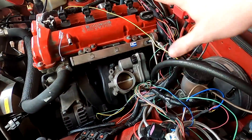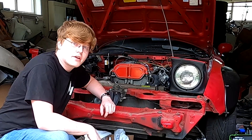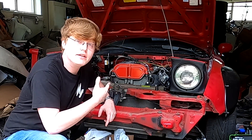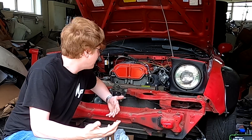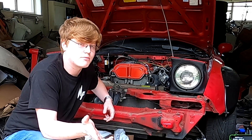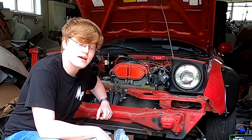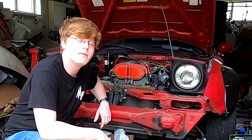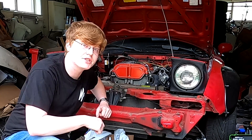Right now it's just a matter of reinstalling the intake tube and plugging all the sensors back in. Aside from that, the only thing left to do is to put more oil into the car. I didn't need to drain the oil to perform this relocation, but the oil system now has a higher capacity because there are new lines and a bigger oil filter — so you're going to have to top up on oil, let it run for a little bit, check your dipstick, and then go from there. Many thanks again to SPLAB for supplying the AN line and the fittings for this video. Be sure to like the video if you liked it, and if you're a first-time viewer, be sure to subscribe — I'll see you all next time.